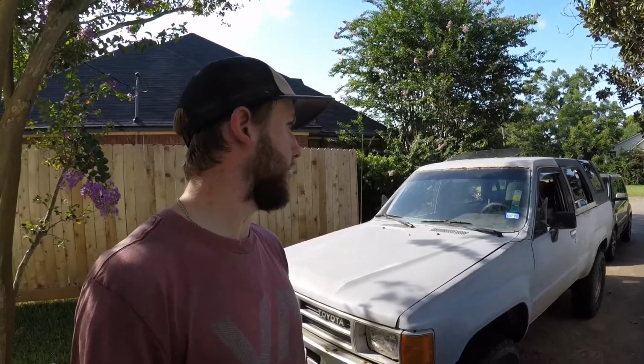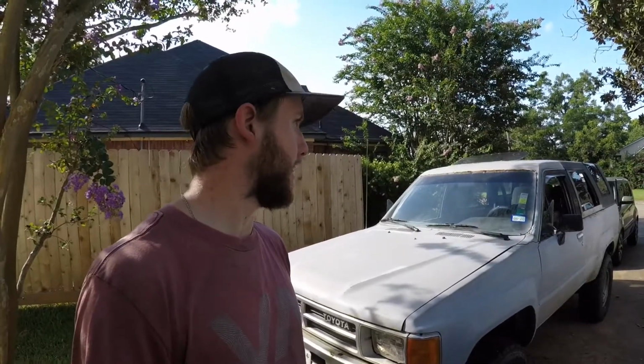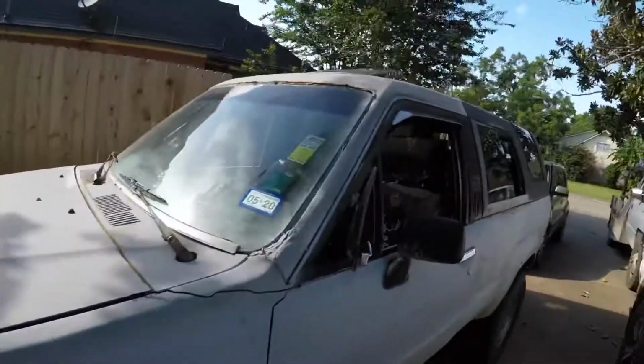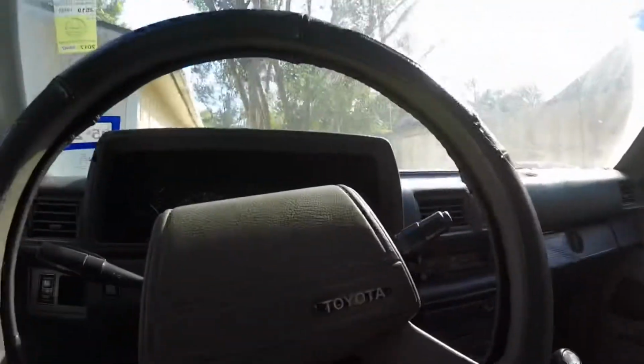But yeah, other than that, I lowered the idle a little bit. I think, yeah, it needs a real tune, but I lowered the idle because it was just running at 2K, which I didn't like. I don't know what did that. Maybe I clogged the IAC or something when I disconnected those hoses to remove the intake. I don't know. Let's see how it starts. Probably even starts worse now that I've kind of tuned it so poorly, but we'll see.